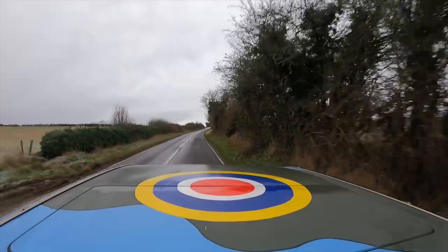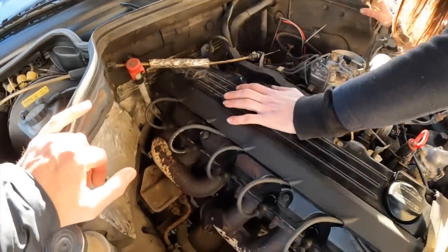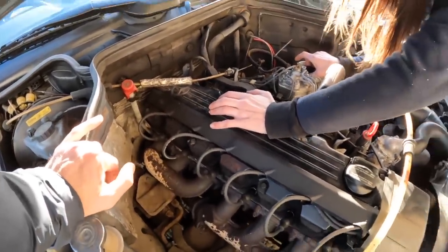Generally speaking though, Bismarck does seem to be running better. I've done a few bits — cleaned the distributor, cleaned the contacts to the coil, cleaned a few other contacts, and we found that vacuum leak — and it is really running better. Something else Jasmine found is that the throttle cable is really not usable, there's so much slack on it. That's also why it feels a bit weedy low down — simply because there's such a load of play in that throttle cable. That's a quick fix.